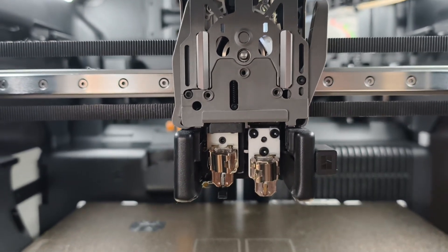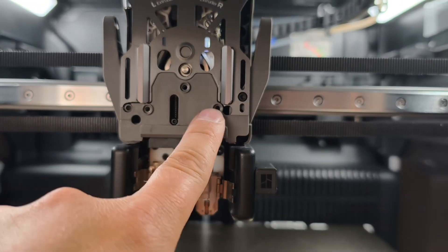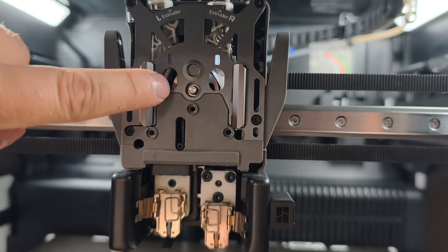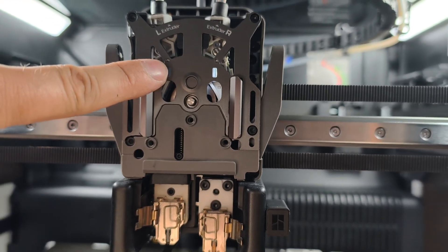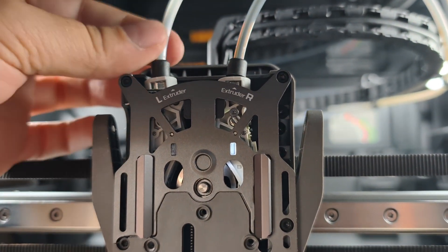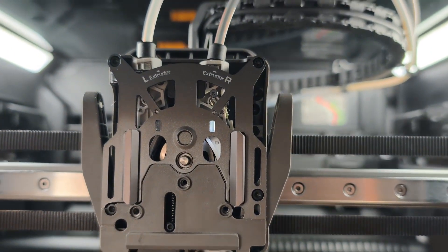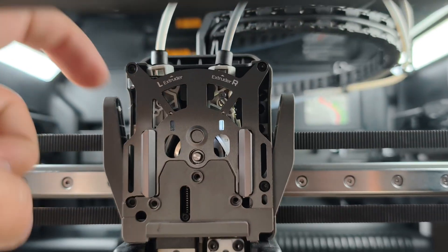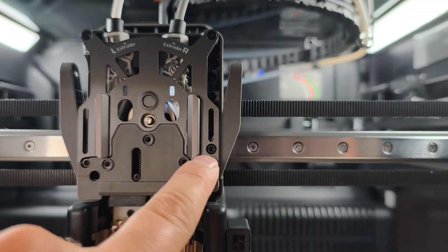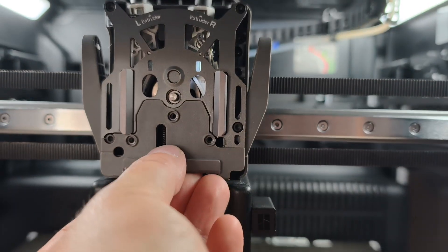Basically you want to remove your front cover, then remove both of the nozzles — very straightforward. Once you've removed these three screws, pull the filament out as far as you can at the bottom and try to pull the filament up here as much as possible, which you can do by depressing these little black things and pulling the cord out. I'd advise doing this with the AMS off, because if it's loaded it will try to feed the filament out and it gets messy very quickly.